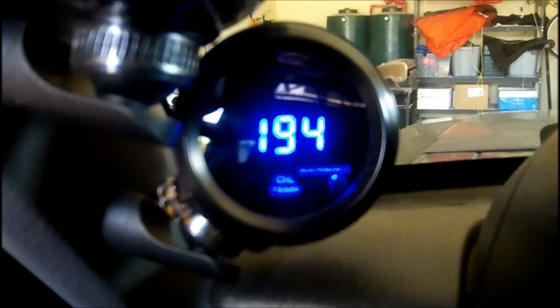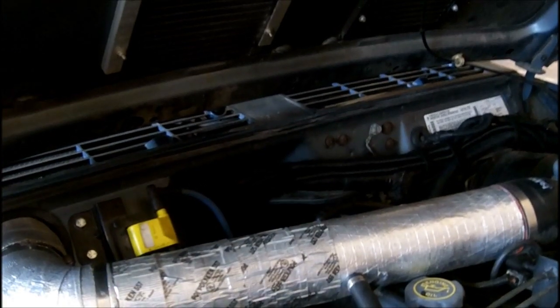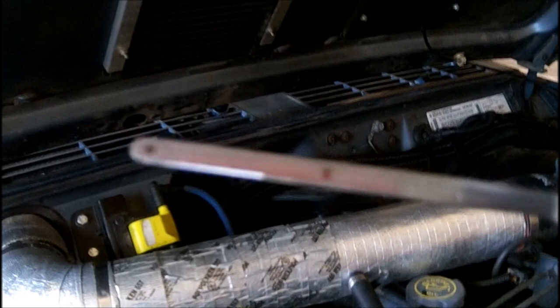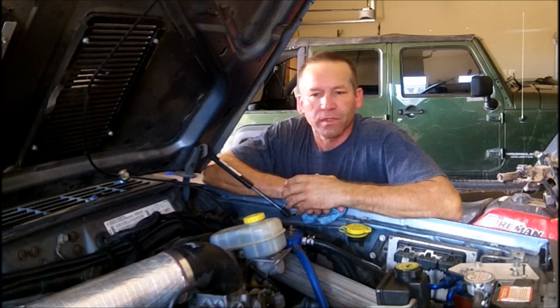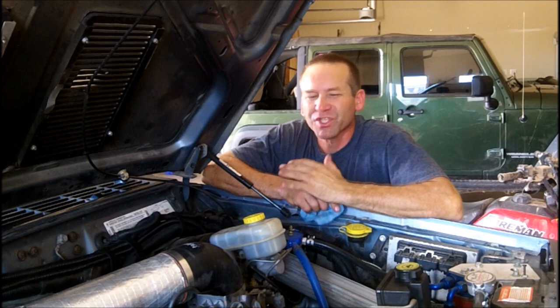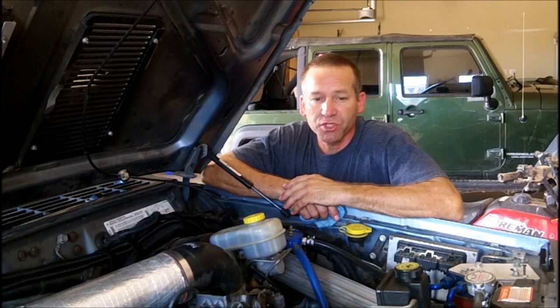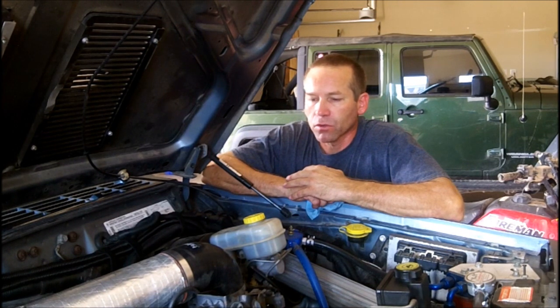Okay, I got the transmission filled up. I've got it up to 194 degrees — that'd be a good normal operating temperature. Let's go check the fluid. All right, not sure if you can see it or not, but that brought it right up to the max mark. I'm happy with that. That all went real well. Got the transmission fluid right up to the max mark, which is kind of a good idea if you're a rock crawling type and you get in those situations where you're going up some really steep hills. I've heard of where transmissions will disengage because the fluid is pulling away from the pickup because there isn't quite enough fluid in there. So I like bringing it up to the very top.